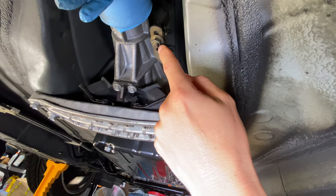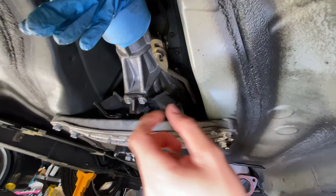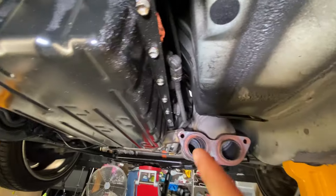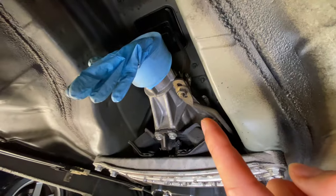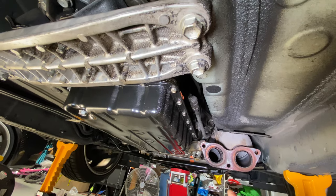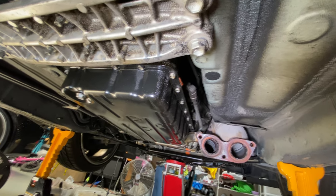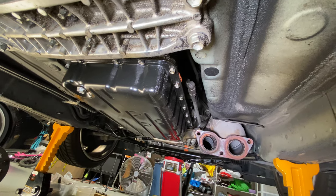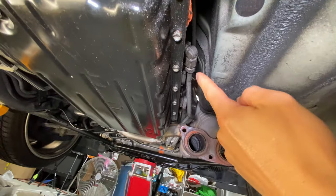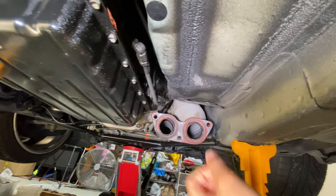Now I've got to disconnect the shifter. A lot of people just disconnect the 10mm, but I think the easy way is to take this little pin out on the side — this part pops right off and you can just take it down. Just make sure you don't lose all the washers. Some people disconnect it up by the transmission, but back here is the easiest spot. The hardest part for me under here is going to be the line. The hard line is one solid line all the way to the front near the radiator, with about three clips or mounts along the exhaust and bell housing. There are also two hard lines going in with banjo fittings — you have to undo those to slip them out.